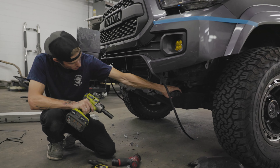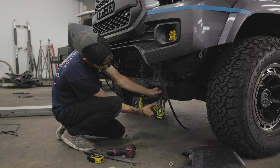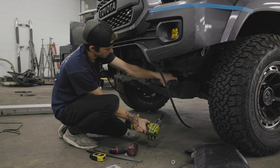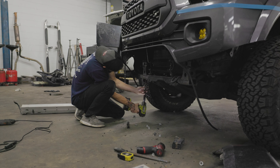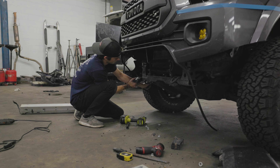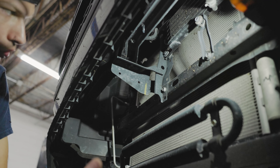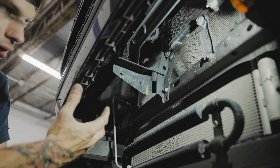This customer has the full plate bumper but we're just doing the Slimline cuts for you right now. So this edge trim is a little bit longer because it will be going the full way around, but I'm just going to put it on real quick to show you what it's going to look like with the Slimline. The method I use is I push it on one area and pull back the other end while pushing with one thumb down — that's the easiest way to get it on.